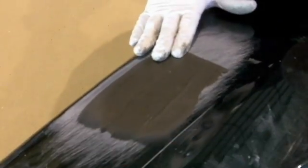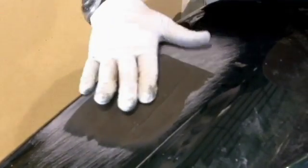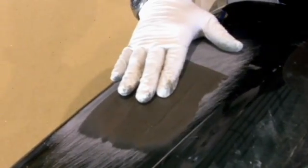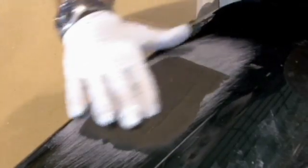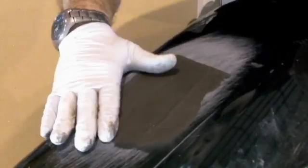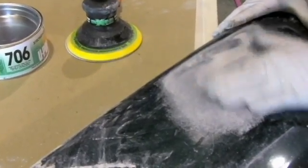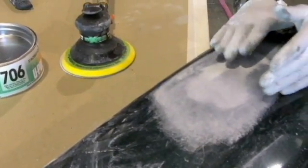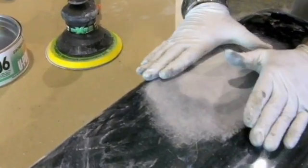One of the really nice features of the 706-1 flexible high-density filler is that not only can we shape with 80 grit, but we can actually feather into the original TPO with 80 grit. With most plastic repair components for flexible bumper repair, you can always shape with 80 grit, but you always chase the hard edge. With the 706-1, we'll be able to completely feather it in on the first cutting with 80 grit sandpaper. After our first cut, you can see there is no hard edge anywhere. From here, we could go to 180, 220, step it down to 320, whatever we need to do to get ready for our final paint prep.